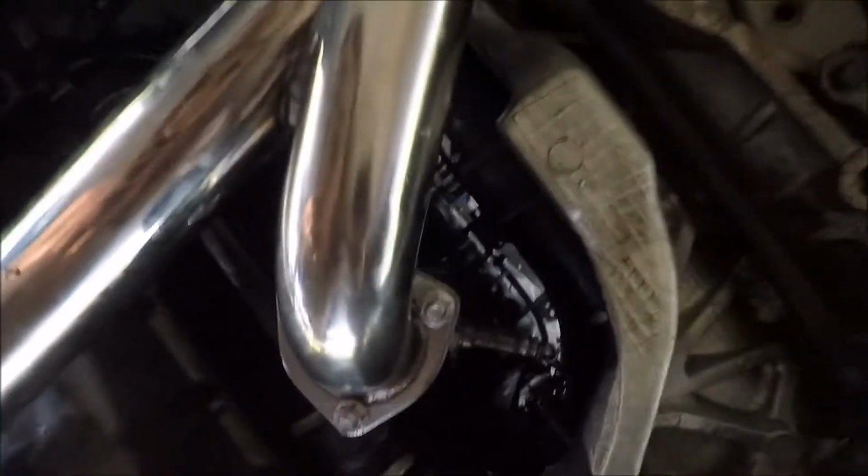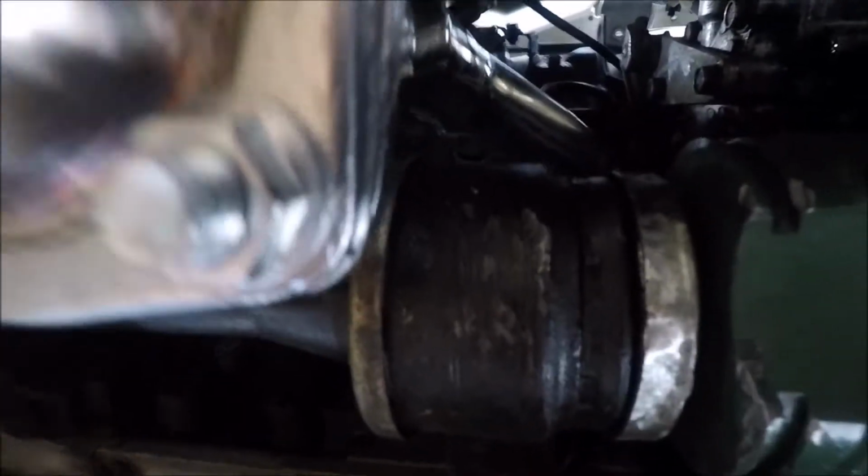When I bolted this up, even without bolting anything up, just setting it down, this one wasn't exactly lining up. So I got all the screws in that one, both of them in there. Then kind of got one in here. Had to clamp it, if you see the little clamp marks. Had to pry it a little bit this way, without the hangers in, to get this one in. Then I clamped it a little more right here. Got that tight, got this bolt in. It took some finessing, but all in all, not that bad of a header install.